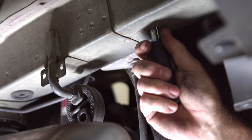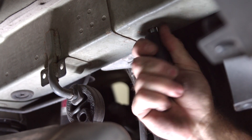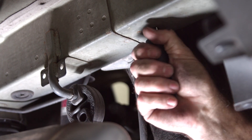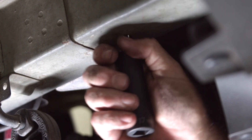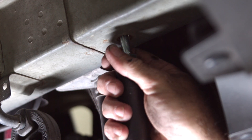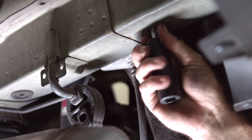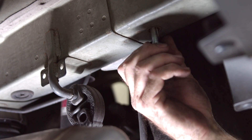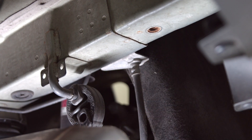Now that we have the bolt started in the weld nut, just going to take a 17mm socket and put it on the bolt, going forward and back a few times just to clean out any of the debris. We're going to make sure that we're not stripping the bolt or the threads. If you feel like it's getting pretty tight and it's not working well, go ahead and take your battery post cleaner and clean it out again. We were able to save this weld nut — looks like it's spinning pretty good. We'll run it all the way up and then run it all the way back, and we'll inspect the other five weld nuts to make sure they're not corroded or need any cleaning.